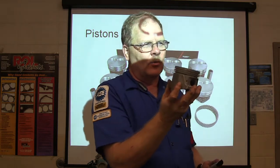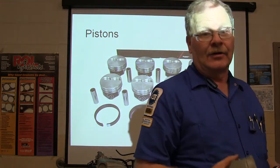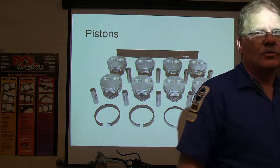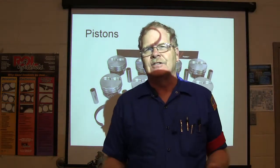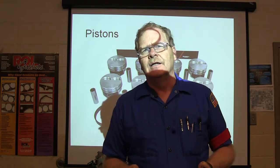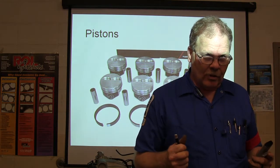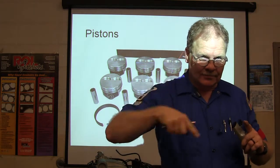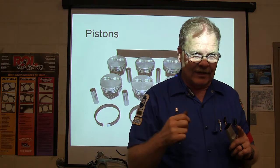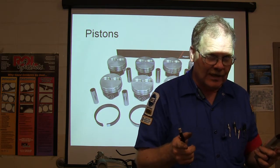And one time, this is a war story for the YouTube people that love my war stories so much. You may have even heard me tell this one before. I built a Volkswagen engine. I was building a lot of engines at the time. My dad had a Volkswagen shop, but it had been years since I built a Volkswagen Bug engine. And so I put all those arrows pointing toward the belt, right? Which I'm thinking the belt's being the front, you know what I'm saying? But the flywheel's the front on a Volkswagen.